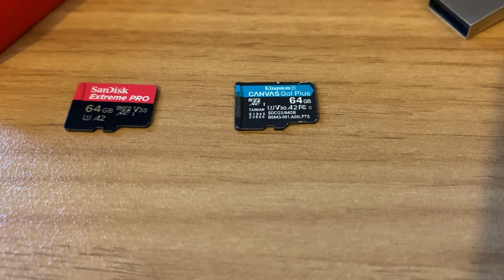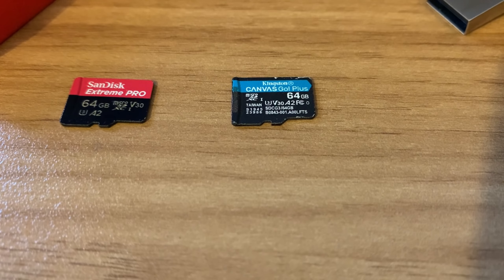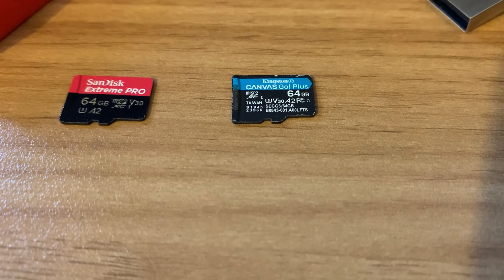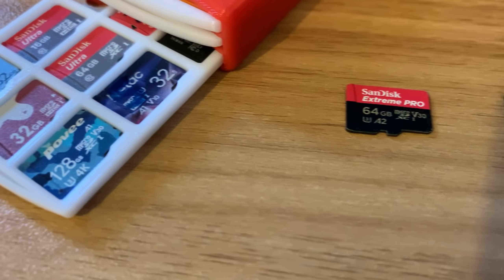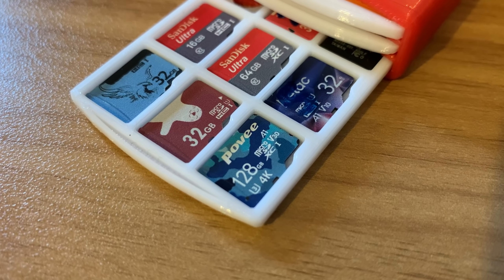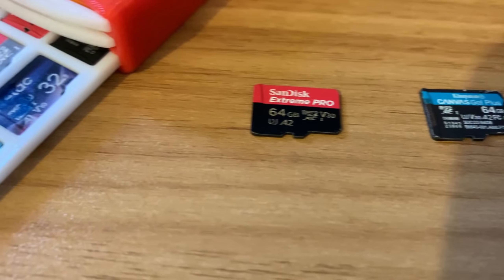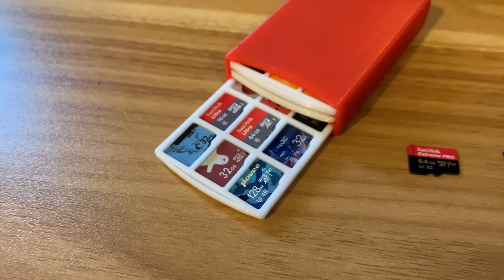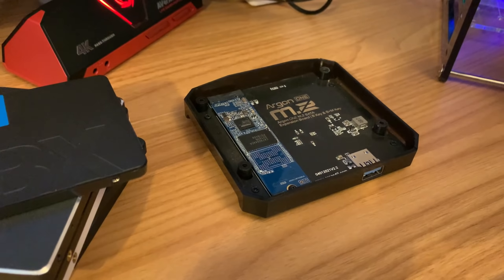For a main starting point, I'd recommend a 64GB card with Raspberry Pi OS as your standard operating system — it gives maximum compatibility with programs, especially for the maker side. I'd also recommend having a few more inexpensive 32GB SD cards so you can experiment with operating systems. The great thing about the Raspberry Pi is you can run multiple operating systems by just switching the storage medium — SD card, USB stick, SSD drive — swap it, boot up, and you're running something completely different.